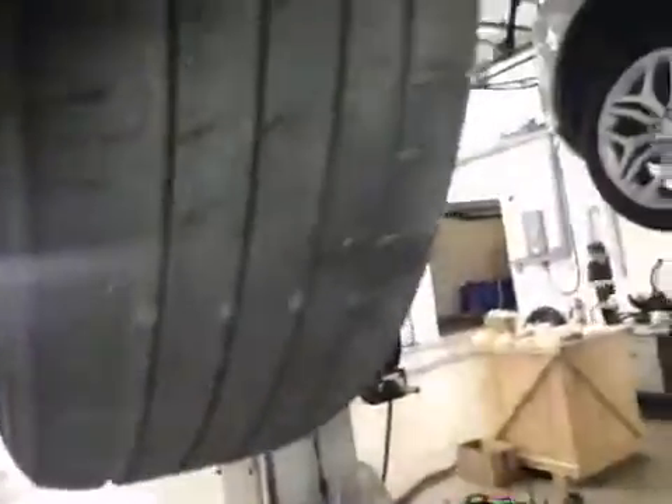Moving down towards the rear of the vehicle, the driveline is also in good condition. Both rear tyre marks in green with more than 5mm tread remaining. Rear suspension is also in good condition. Rear brake pads have 6mm remaining, these are marked in amber.